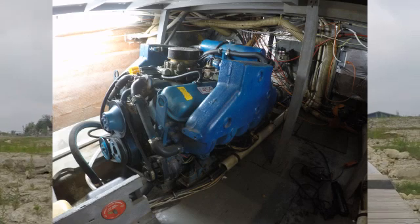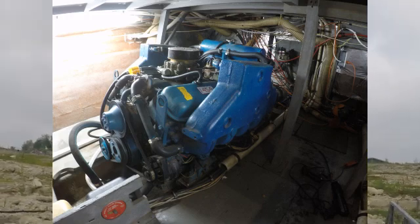Went downstairs to the engine compartment and played with the spark plugs. We've got spark, we've got fuel. The engine wouldn't even start with starter fluid. That's a bad sign. And so I checked the compression. We've got 3 cylinders showing 0 compression. That's not good.